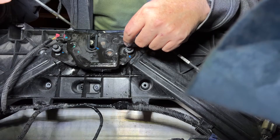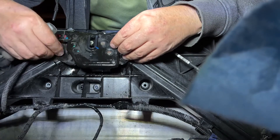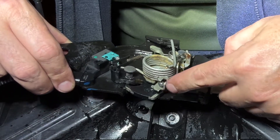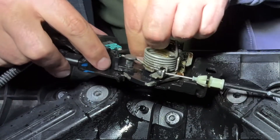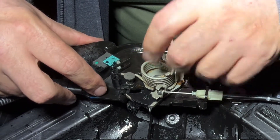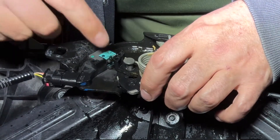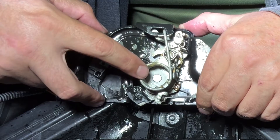The first thing you're going to do is screw out these two bolts right here, and the minute you do that this whole thing is going to become free. When you flip this over, you'll see this is the mechanism that does all of that — here's the cable, here's the little ball, and it actually pulls on that to release it. What was happening was mine was not closing all the way, and because of that this little switch here was not detecting that the frunk was closed. When it's all the way down, you'll see that it's sitting on this little micro switch, and that's what's telling it that the frunk is closed.